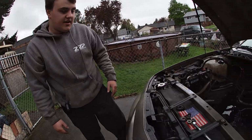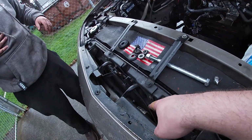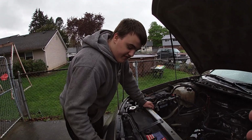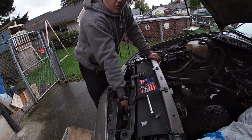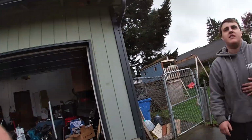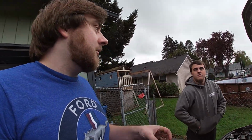Also, since it's an actual radiator, the outlets are really large. These are like 1.25 inch lines, which are really big. Normal GT500s or other supercharged stuff are like 3/4 of an inch, which I'm having to then reduce because it's so big. So I'm using the radiator hoses that were meant for that Jetta and then reducing it to, I think, an inch.